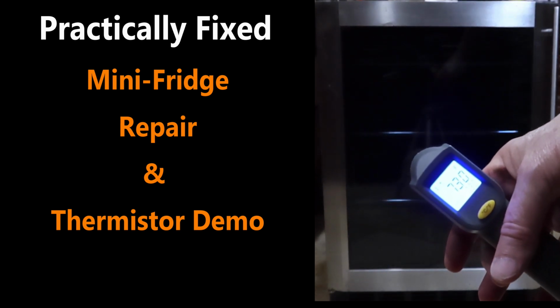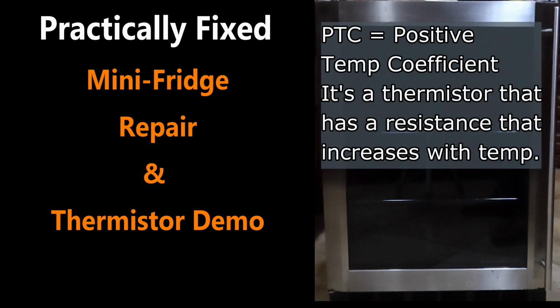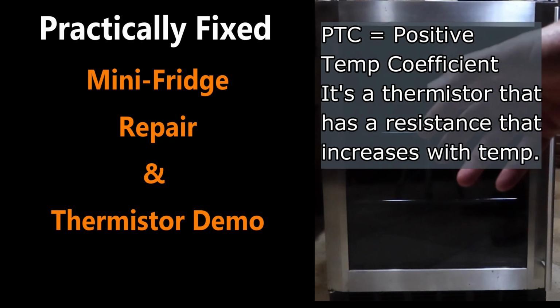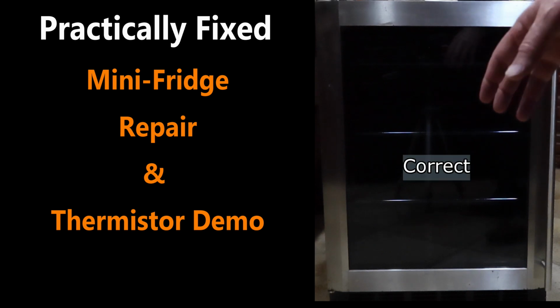Alright, so I've repaired one of these before, and what the problem was is it's called a PTC start relay, which stands for positive temperature coefficient. It's a type of thermistor that basically gets the starter coil winding to get going, to get the compressor running, and then once it reaches a certain temperature it drops out and then the motor continues. I think that's how it works.